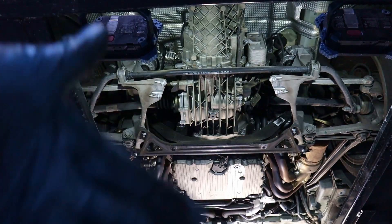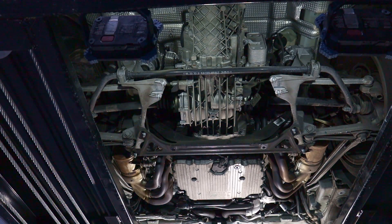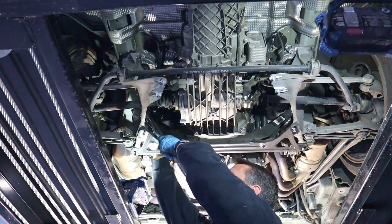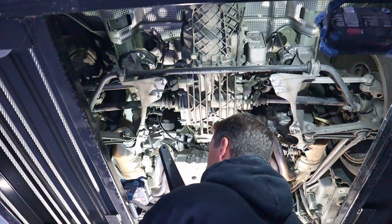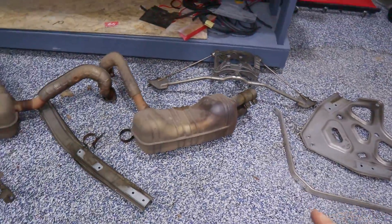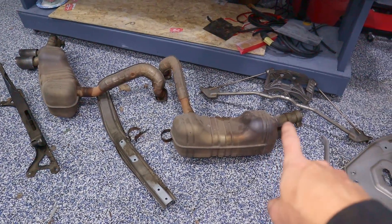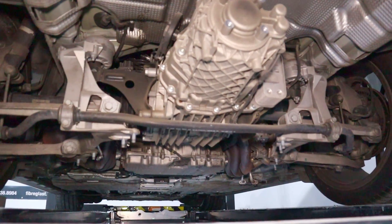The battery just died, but I took the tray off — there were two supporting arms. There's a lot that just supports the weight of the exhaust. I'm going to take off the center brace to get better access to the transmission, and I'll probably also have to take off the sway bar, then take off the exhaust headers. It is amazing how much it takes to support the exhaust — some of this is like a skid plate, but a lot are just brackets mounting to the frame supporting the weight of the exhaust. Each of these must weigh like 30 pounds. The transmission has its own mounts — all that other weight was just for the exhaust.